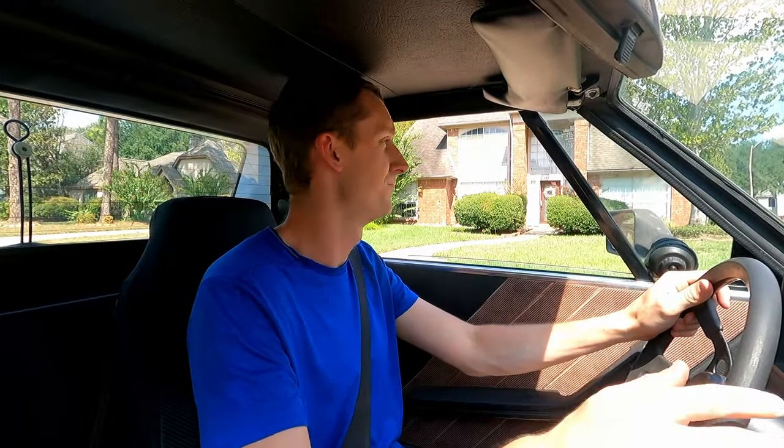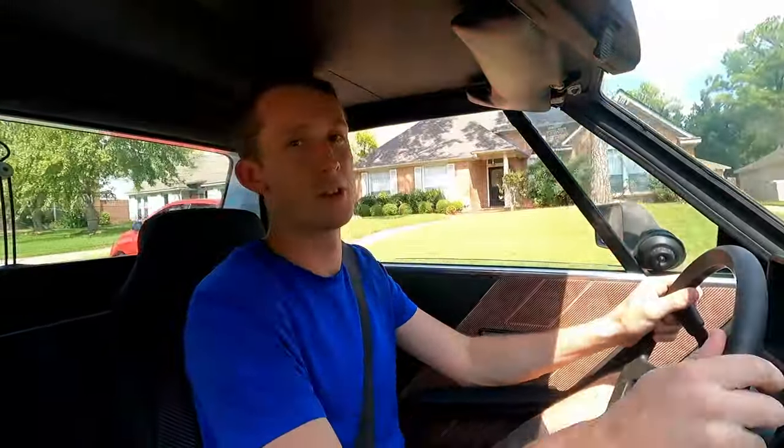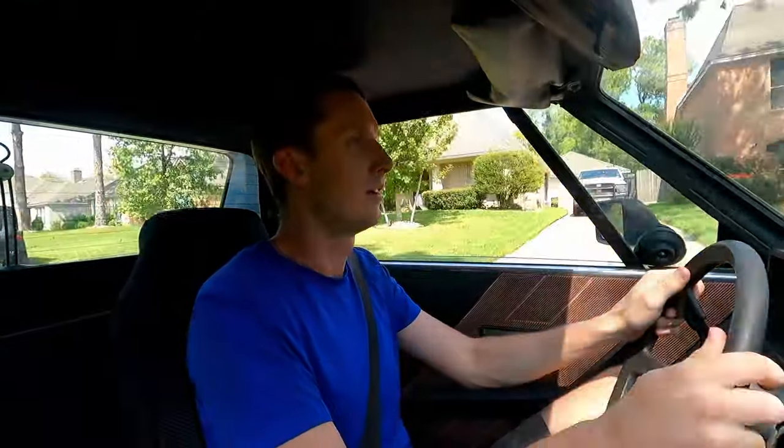Come up to the stop sign. Let's see how we do at an idle. Yep, drops right back down to 1,000. Don't kill it, don't kill it. Like the third gear synchro is not quite happy. When I go into third, you hear a little grind, so I think the synchro gear is not agreeing with us.